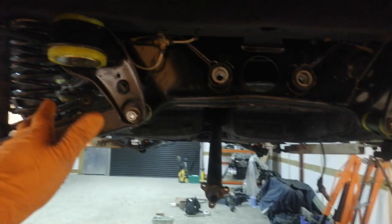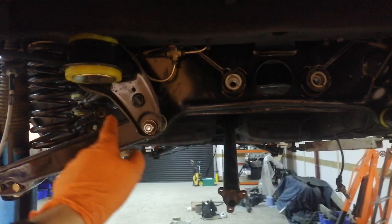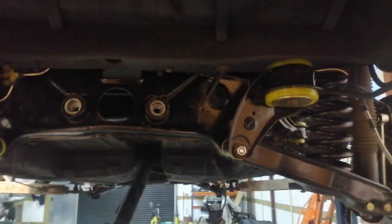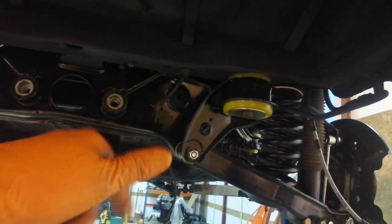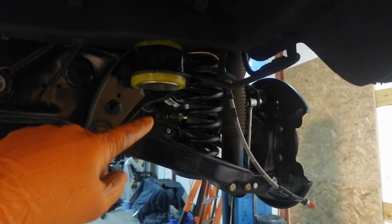And the only other additional thing I would say is it's 70 Newton meters to tighten these up. And obviously rubber compresses, so you can see there's a slight concave happening to the washers as they're going up. Or polyurethane compresses as well, or a little bit less than rubber. But what I did was, it's 70 Newton meters on these, 84 or 90 on a W124, so I put 84 Newton meters, which was just the next guiding point on my torque wrench.